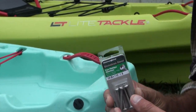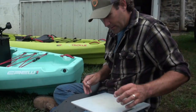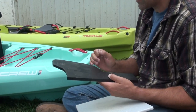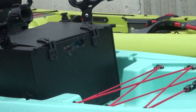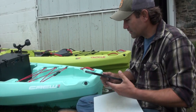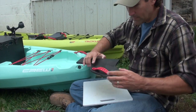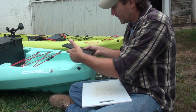I made sure that I got the right length stainless steel quarter-twenty bolts. I've used starboard before - this is an older piece I used to make a custom mount. It's the same material used in the Yakattack black pack. That's a thinner one, I think that's quarter inch, and I think this is half. So this isn't quite half, but I think it'll suffice. I tested the length - put the bolt through there. I'm actually going to reuse the handles, and I'll cut out a portion so you're not trying to get your hands in there.